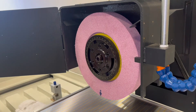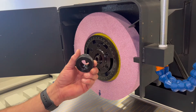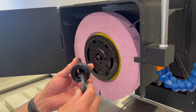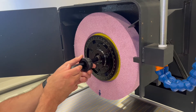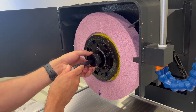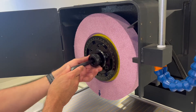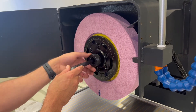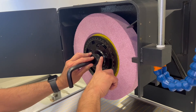That looks just about right. Next, I'm going to put my locking nut over my Allen key. I'm going to place the Allen key in the middle, holding my ID differential screw in place while I thread on my locking nut. Then, this you're going to turn left-handed also, until the thread actually meets the wheel flange.